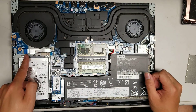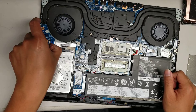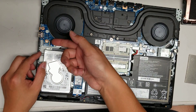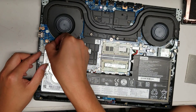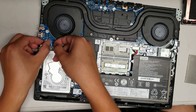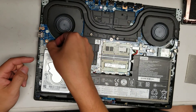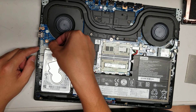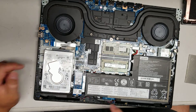The LCD connector — just like these little connectors — you just flip this little latch up. Hopefully you can see that little black latch. Once you flip the latch up, you can actually pull the cables out. I think they used an adhesive or something. Then you can pull these connectors out. To put it back, just make sure the latch is up, put the connector in, and then put it back down.